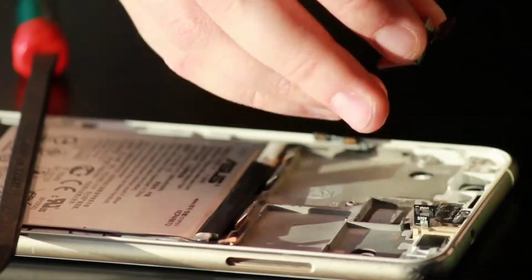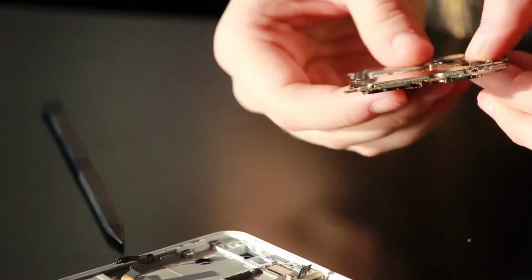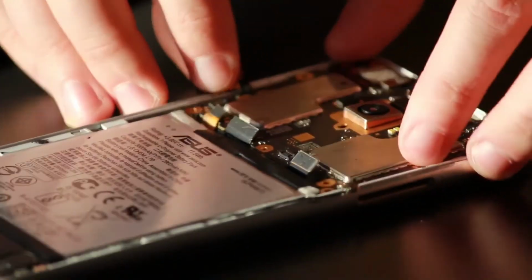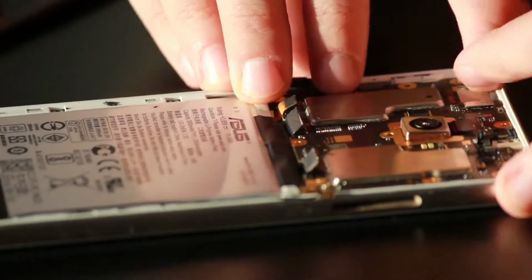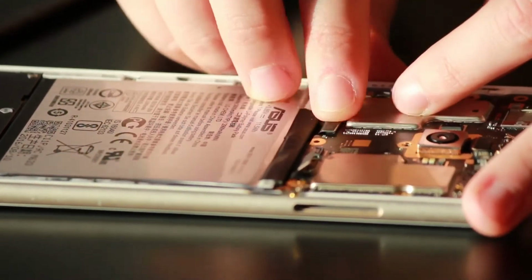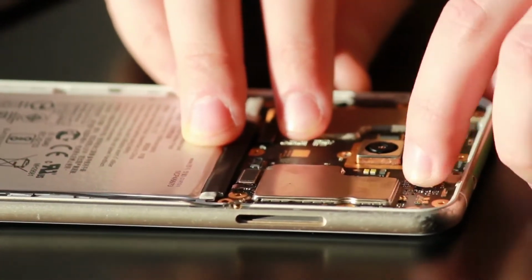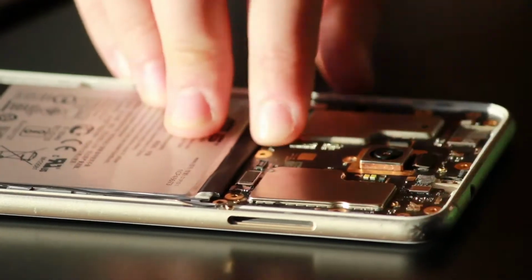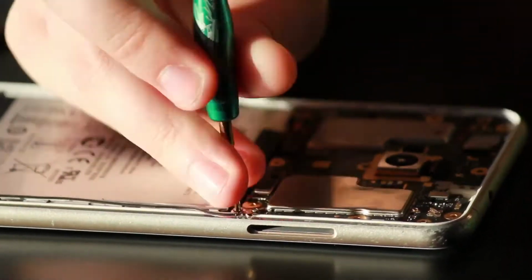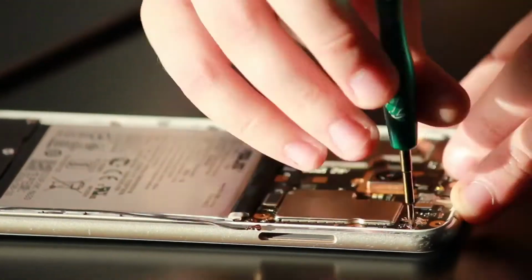So once you have that removed, you'll want to connect your new back-facing camera into the motherboard and then kind of gently shimmy it in. Make sure everything's out of the way so that you can reconnect everything. We're going to go back through, reconnect all the front-facing camera, back-facing camera, power button, battery. And you're going to want to take the screws, the 3 screws for the motherboard, put those back in.